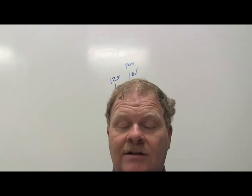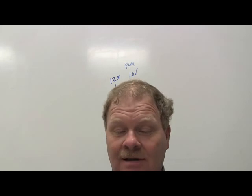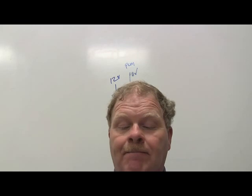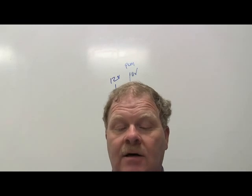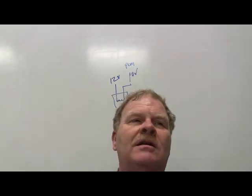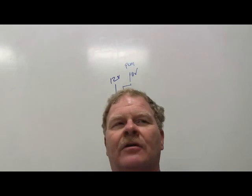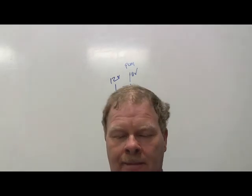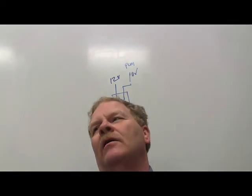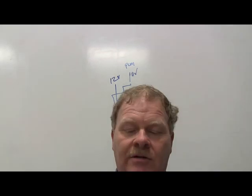A wideband oxygen sensor heater can draw how much current, in amps? B, that's going to be 8 to 10. Yeah, that's a lot of amps. Well, why is that? A wideband oxygen sensor's got to get to 1400 degrees before it really starts to work right. The older ones, the zirconias, 600 degrees. They put the heater in there to bring it online quicker. The quicker they can get that thing paying attention to the oxygen sensor, the better your emissions are going to be.